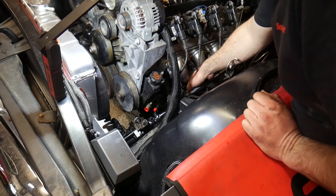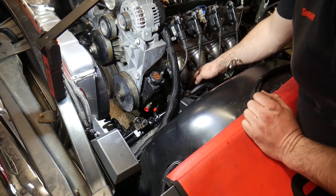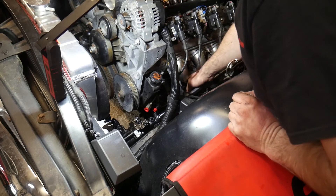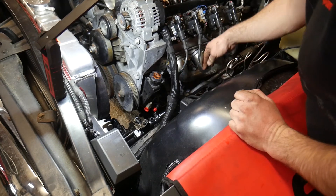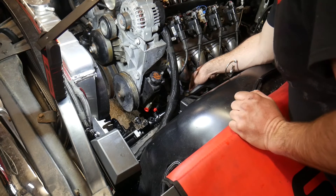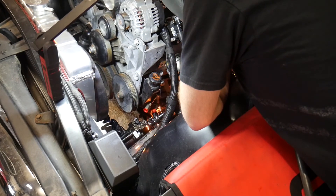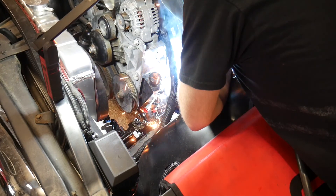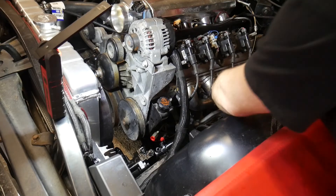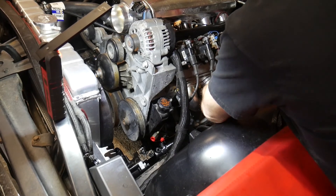Now that I have it all hooked up, I'm going to mark where the shaft is. It'll be too hard to get in here and drill, so I'll mark where the shaft is located, take it back to the bench, drill it out, and get the bolt put in. There's not a lot of clearance in there, so I think I'm just going to weld it. The instructions say it's more difficult to service if you weld it, but I'm not really planning on taking this out again. I went ahead and slid this slip yoke up — there is enough there to disconnect it in the future if I need to.